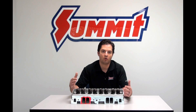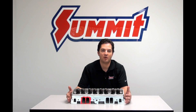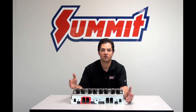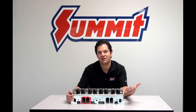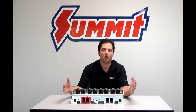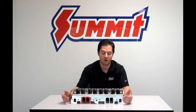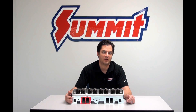In most cases, our goal with runner size — especially on the intake side — is that we want to keep air speed up. We don't want to just be able to take in a lot of air; we've got to make sure that air is able to move at an efficient rate. If you've been paying attention to pro stock over the past 20 or 30 years, they've gone from very large ports down to smaller ones because it's more about efficiency than volume. Therefore, it's very important to understand how runner sizes relate to your engine combination.